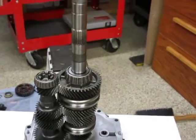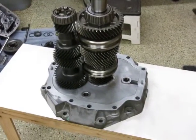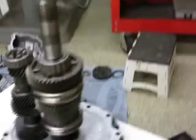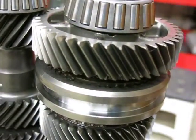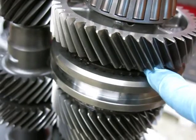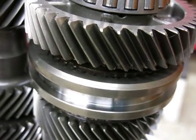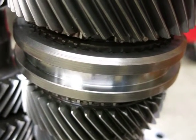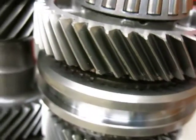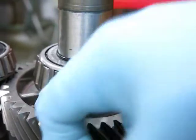I've now reassembled the main shaft and the counter shaft back into the transmission end plate. In the process of installing the main shaft, I also finished installing the first gear assembly. This is the first gear, and below this is the first gear synchronizer cones. The outer ring for the first gear synchronizer cone is all steel and there's not a replacement in the kit, but there is a replacement for the carbon fiber inner cones. I installed that, installed the bearing, installed the O-ring — this is the new O-ring. There's also a needle cage bearing inside of first gear.